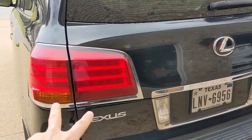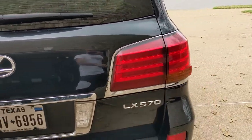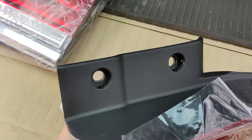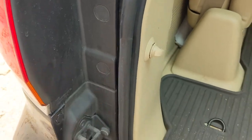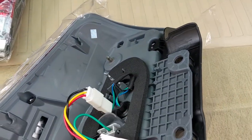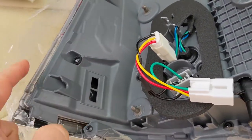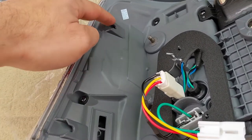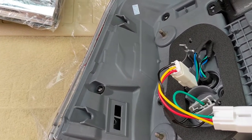As you can see there are two pieces on each side — there's the outside and the tailgate piece, and same on this side. Looking at the new pieces to see where all the mount points are, we've got these two holes which correspond to these two here. Little covers on there that probably pop off to reveal a mounting bolt, and we've got two push pins right here and right here that push into clips. And there's these two as well — with the shape of those, I'm assuming those are push pins as well.